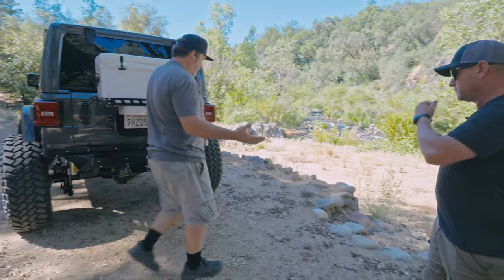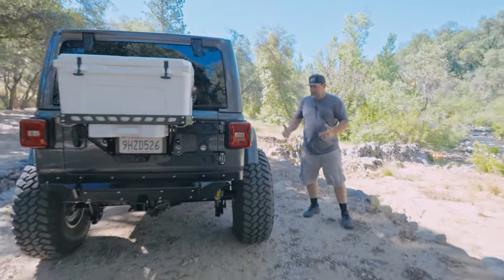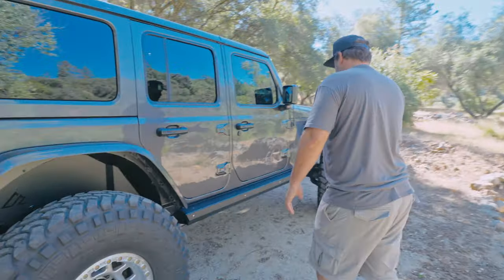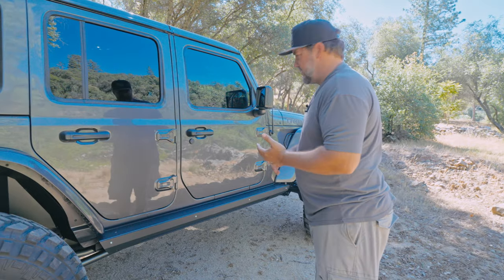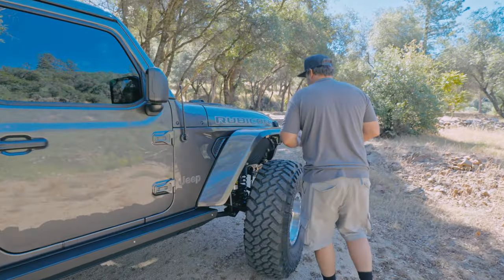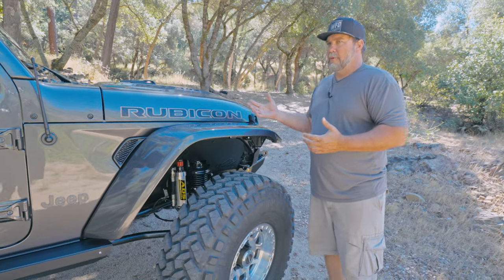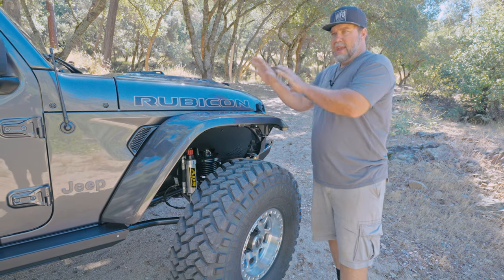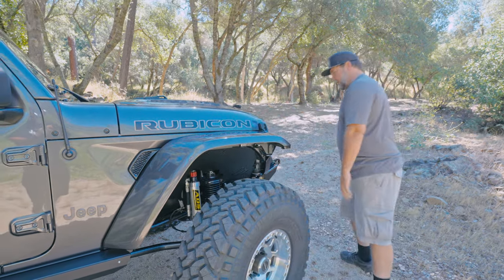We ended up going with a 1410 rear CV in this. Correct. So if you got a Dana 80 in it, you got a 1410 yoke, you might as well do a 1410 CV. 1350 in the front, PSC hydro assist, like we said. And, you know, I've been preaching this to a lot of people that the PSC has come a long way. And so you've driven it a couple hundred miles. What are your thoughts on handling, drivability? Like, does it make it loose or darty or anything like that?